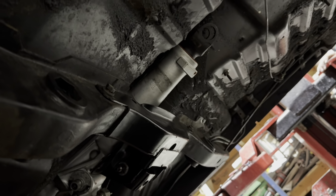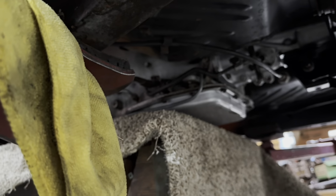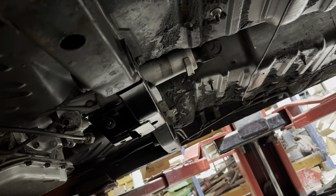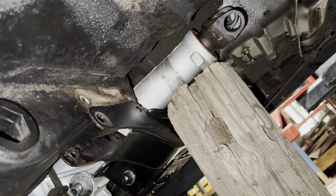So basically, going to hammer out those 2 bolts, but there's a ton of pressure on them right now. So what we're gonna do is put the jack underneath the tail shaft, just take the weight off. It'll balance on the cart okay. We may have to reset it a little bit, but I don't want it obviously falling off backwards here. So we're just gonna use the jack to take the pressure off because I don't want that thing falling on my face. All right, bolts out, cross members up.